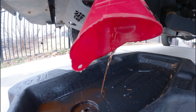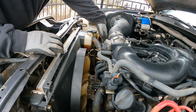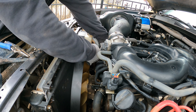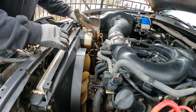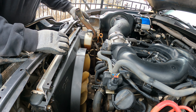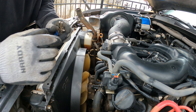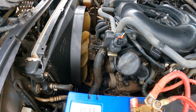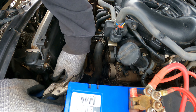We're just going to let that keep draining and then move up to the top. Since that's draining, we're going to take off the reservoir hose. Since we have the aftermarket hose from Mishimoto, we're going to take this clip back and then pull off this hose — that's it for that. There's a little bit of fluid up in there. We're also going to move further down.